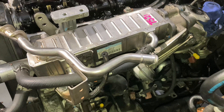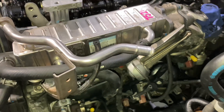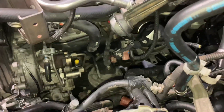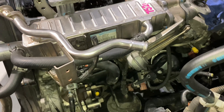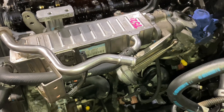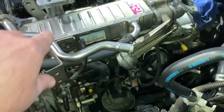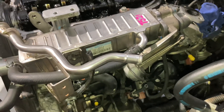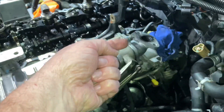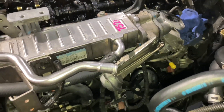This is something I've previously discussed: if you haven't got much EGR flow or no EGR flow, now might be a good time to consider something. At the moment you've got coolant flowing through the EGR cooler. You've got exhaust gases going through it — 300, 400, 500, 600 degrees — and the coolant is about 80 to 90 degrees flowing through in a separate system. The problem is if there's any perforation or internal leak, that coolant gets into the air system of the EGR cooler and into the intake.